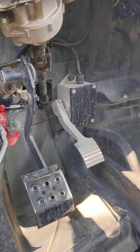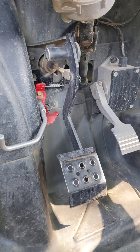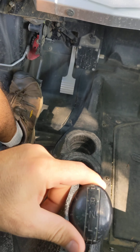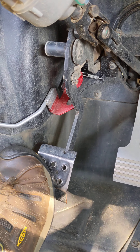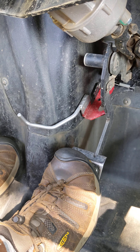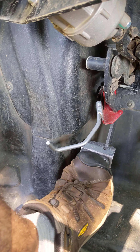The most helpful change is this brake — this is an emergency brake, if you will, that hydraulically holds all the cylinders in a closed position. So I don't have to use the park anymore. The park on these razors sometimes gets stiff if you're on an incline and you want to release it. So that way I don't have to use the shifter at all. With this mod there are a few companies that make these — I modified this one to have a hook all the way out here for easier engagement. You push the brake over and all four wheels are now locked. Push it in and it's released.